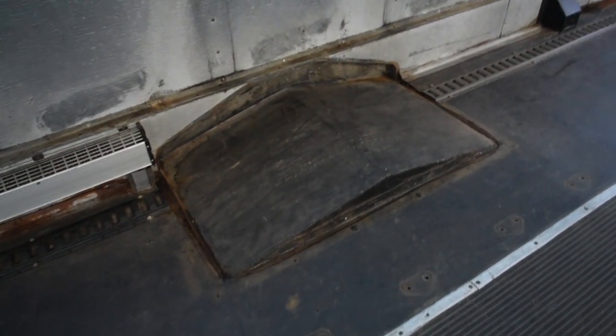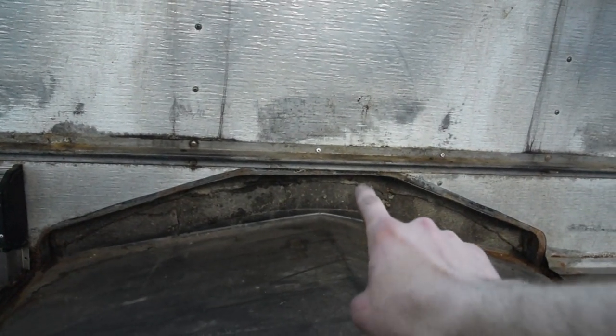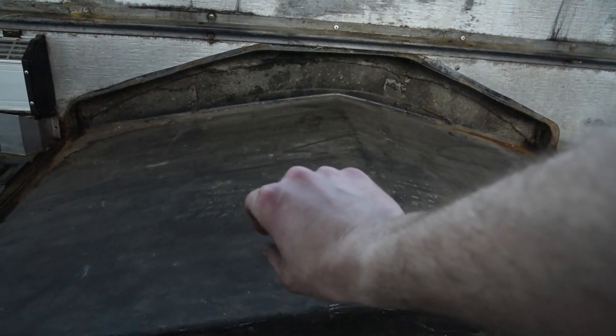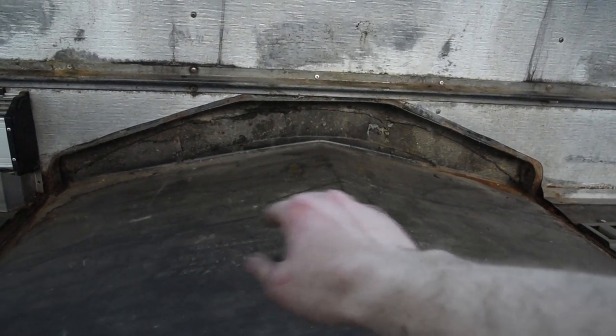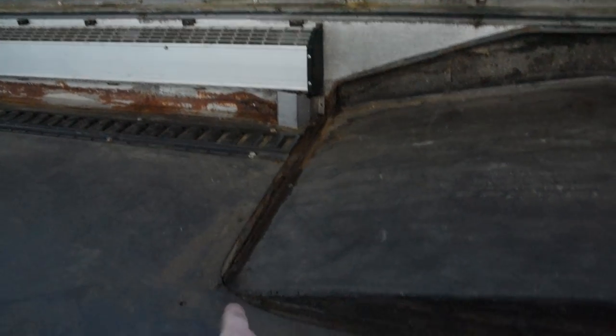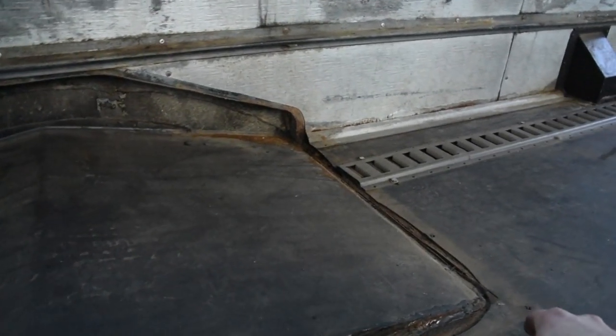These are the shortened wheel well humps. We shortened these because the problem is when you drive a vehicle inside with the tall wheel well humps, you can hit the ceiling if you have a roll cage. I believe these are about four and a half inches tall - we took about four inches off the top. This is all new steel; we did not use any of the original steel of the wheel well hump. We went to a place that had the steel and had them bend it in the center. The steel looks like it's just a triangle but it's actually not - down here there's a few inches that go up, then it's bent, and then it bends down. It's shaped so the sides dip down into the floor, and then it's welded and sealed all the way around.